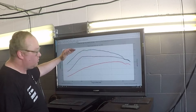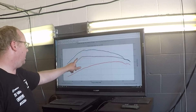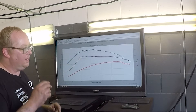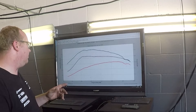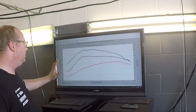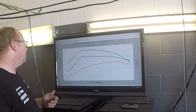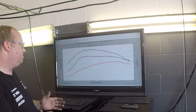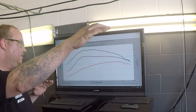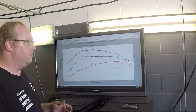What matters is how quickly the intake came up. The boost actually crept higher — about 22 psi — and over the full range they end up about the same toward the end of the graph. But you're really seeing the boost and torque pick up right away including the horsepower, so that's something to consider about this intake.